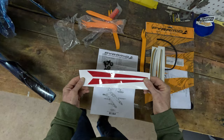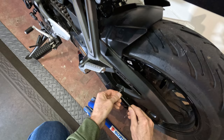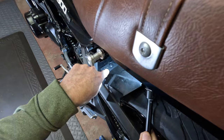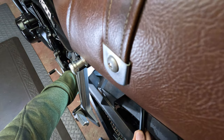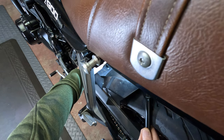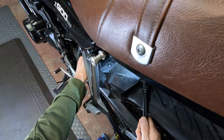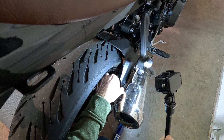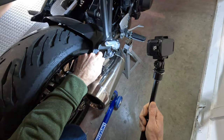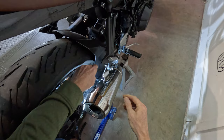It comes with stickers for my color scheme and also ones for a yellow bike. I've made a little short allen key — 5mm — which fits in here nicely. There are two points to undo on the swing arm. On the other side, unless you have a short allen key you're going to have difficulty clearing the exhaust. If the short key doesn't work I'll have to loosen a couple of exhaust mounting points to lower the pipe and gain access.